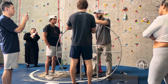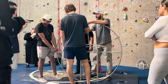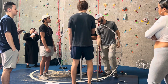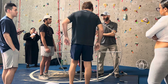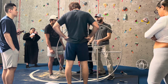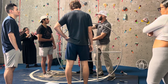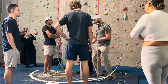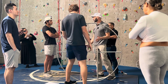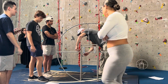There we go. Slide that in. Now for the swing arms, and y'all are going to see this on the first flight of this model, I get a crazy takeoff. You'll get to see this in week 14. What happened is the weight shift was off. I didn't put any weight shift on these swing arms. Depending on which way the propeller goes, you get counter rotation where your harness wants to twist and it'll cause you to fly the wrong way. To offset that, we do a weight shift offset. But I didn't realize this electric engine was going to have that much torque, and I almost crashed on takeoff. So you'll get to see that in week 14.